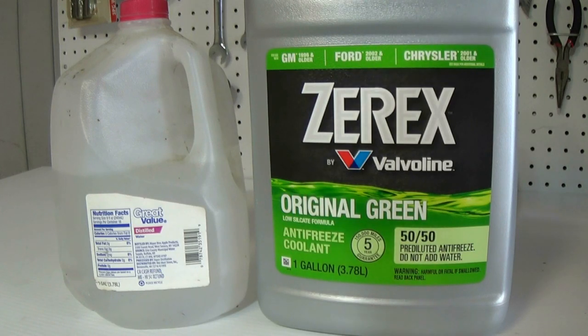There's even coolant on the market that goes a step further — it is actually waterless. I know of one company off the top of my head: Evans Coolant. Since it does not use water, you basically never have to change it. The guys with fancy Packards, Duesenbergs, and Cords — those big classic cars from the 20s — have extremely delicate and expensive radiators, so they go the extra route and get waterless coolant. I don't think anybody is going to put that in their tractor. It's about 60 to 80 dollars a gallon — pretty crazy. But that is why I use the 50/50 mix.